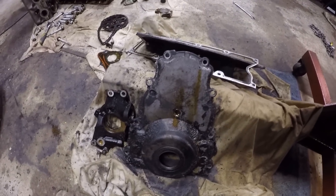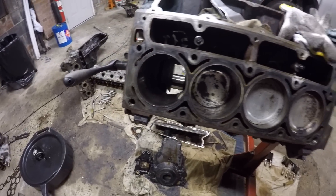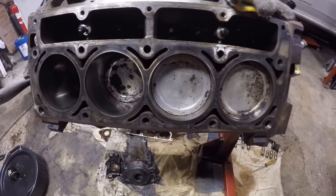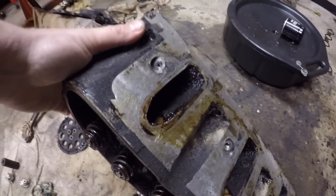This is after I've been scraping and spraying off — this thing literally had an inch of cake on the front and everywhere. I sprayed it with degreaser, but a lot of it wasn't cutting it, so I'm scraping everything with a razor trying to clean it up. Just look at the valve covers, they're really cakey too. You'll be impressed with these intake ports — I tried cleaning them up a bit and they have just cake, so much sludge. It's really thick — you can feel it with your finger, like half an inch thick of just buildup.